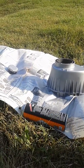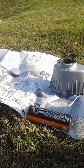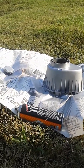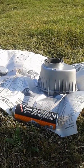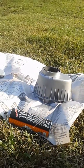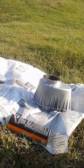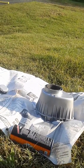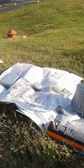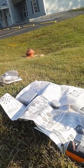This is not just so much for cosmetics — this is budget hot rodding, and hot rodding is not always just about looks. This is also about improving the performance of your vehicle. This box houses the airflow sensor. If this paint reflects heat, it'll cut down on the wear and tear of that part. It'll also help keep the air going through there a little bit cooler, because by the time it goes through all that tubing and gets up to the top of the engine, cold air induction is not what it is. Anywhere you can get on the engine and get some parts to not soak in as much heat, that's a big help. And it should be a no-brainer that electronics and heat do not mix well, so by doing this we'll cut down on some of the heat going into the fuse box.